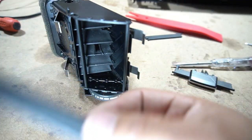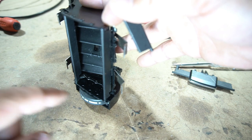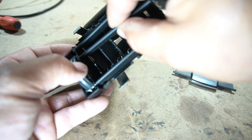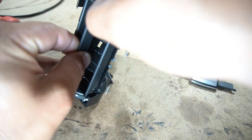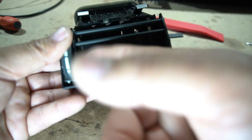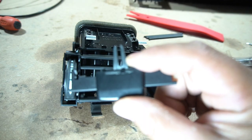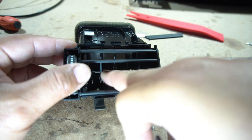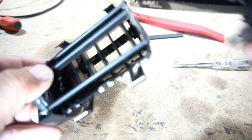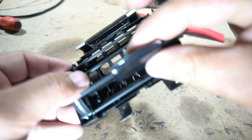Now we simply grab one of the remaining louvers and install it — this helps hold everything in place. The bottom and top ones clip in from the left, and these ones clip in from the right. Putting this in will hold the bracket in place. Get it in the hole for the bracket and then get it in on this side. It's now holding the bracket in place. It's very important that you get this slot here into the middle vertical louver — it has a spot for it right there. Put it in there so that it can turn the vertical louver left and right. In order to fit this back on, we need to make sure that fork clips into it perfectly in the center.